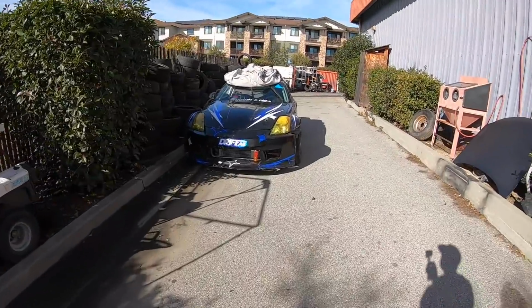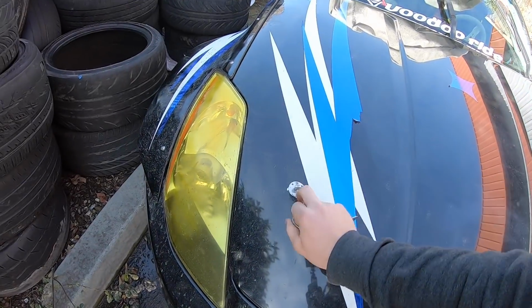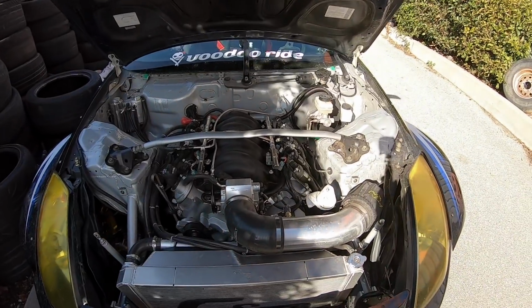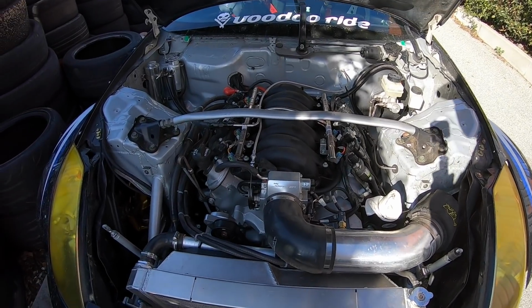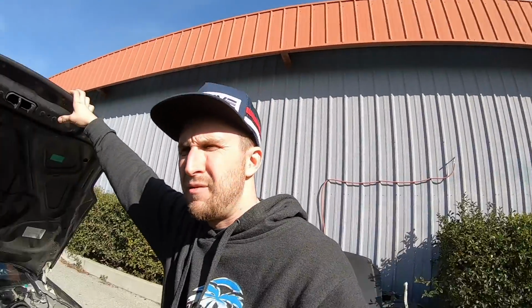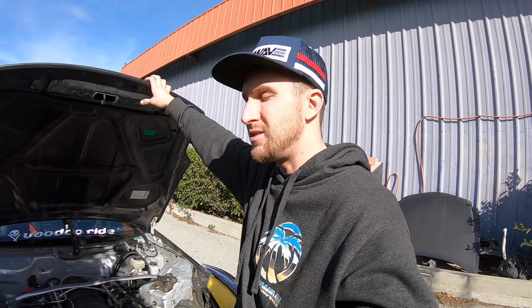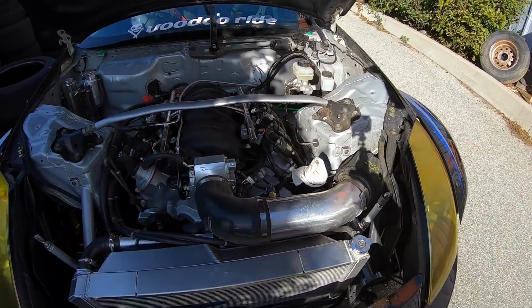This is Ash's car. This thing is really nice. It's a powder coated chassis. It's basically a Formula Drift Pro 2 ready car minus maybe some horsepower, because this is just a naturally aspirated LS3 crate engine from GM. We put a Texas Speed cam in it. It has an ISR swap kit, so it's got all the headers and long tubes and everything. I think it made 490 or 485 at the wheels, something like that, and that's stock with the cam. Nice CNR radiator, Spal fans, of course AEM intakes, all the normal stuff that we do on the competition cars on my side, we put into all the customers' builds.